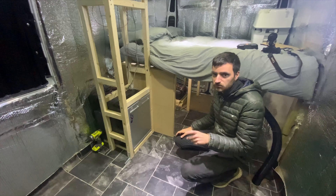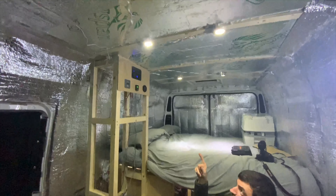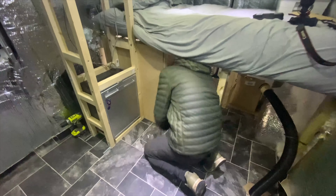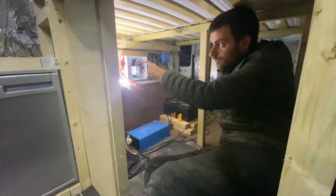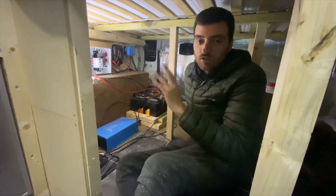We did wire the fridge into this, but the issue was it apparently can't run through a switch - at least it couldn't run through this switch up here - because every minute it would cut off and cut back on, and it would trip all the lights so they'd blink and come back on. We looked through the manual and didn't really see anything, so went online and yeah, it says you can't run it through a switch. So what I did instead was run it straight from the fridge through to the battery with no switch, but there is a fuse inline so it is safe, and there's a switch inside the fridge anyway that Rob can use.